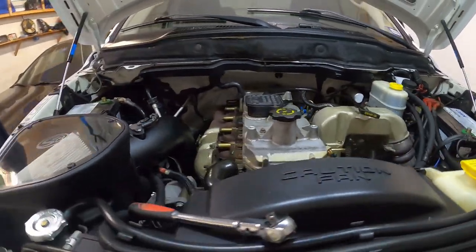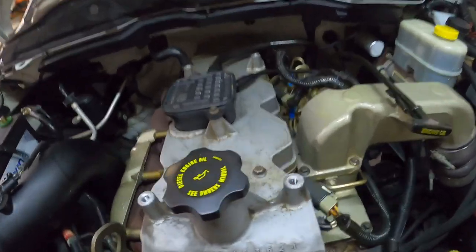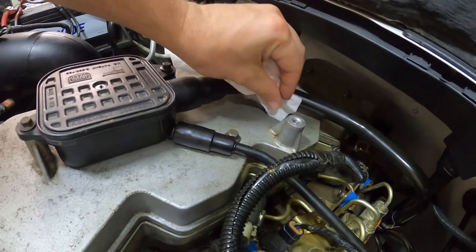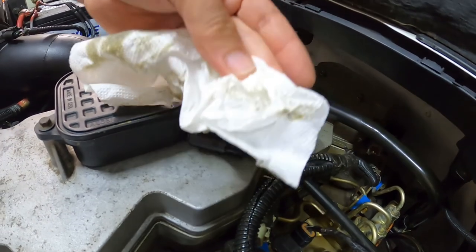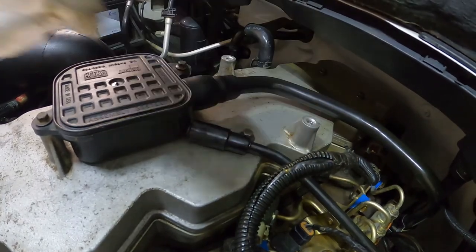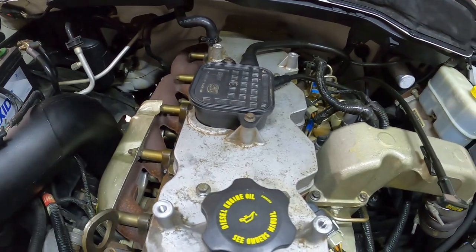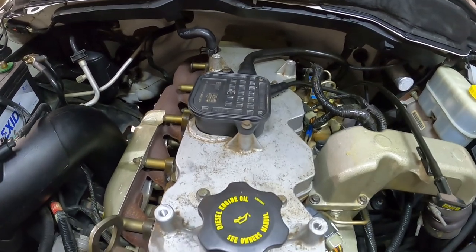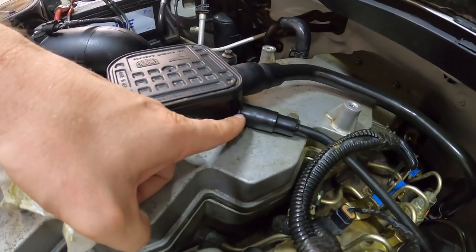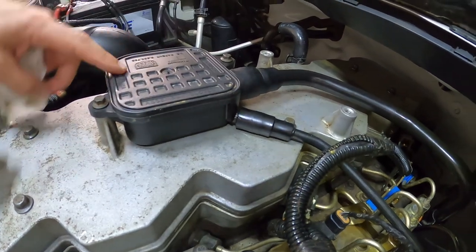I got a paper towel and I rubbed it on top of my valve cover, and my suspicion was right. There is an oil film on my valve cover — just a light coat — see, all that is oil from the valve cover. So it's coming from somewhere, obviously on top of the valve cover. So I'm thinking it's got to be this guy right here; it's probably leaking out from one of these tubes. So I'm going to replace this.